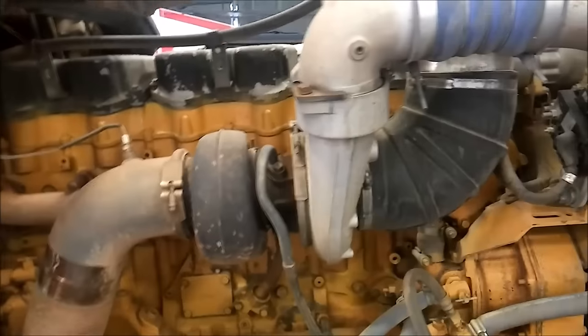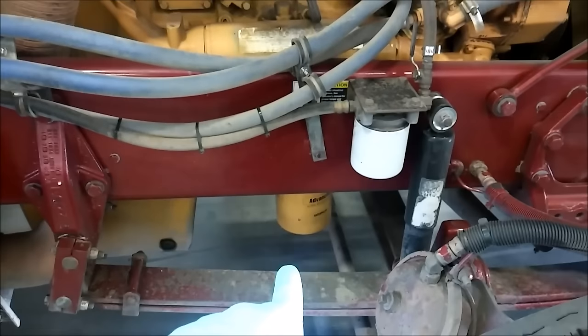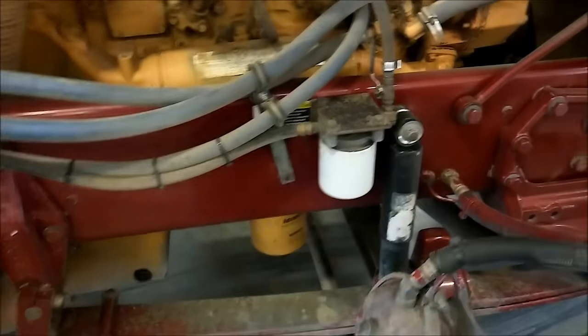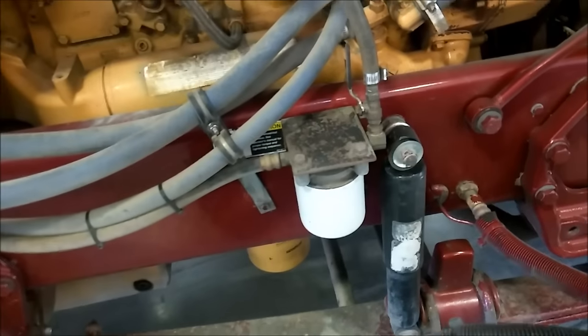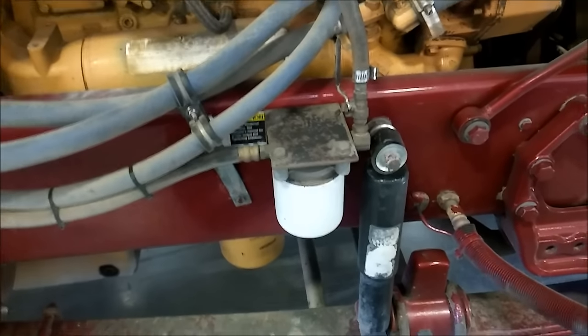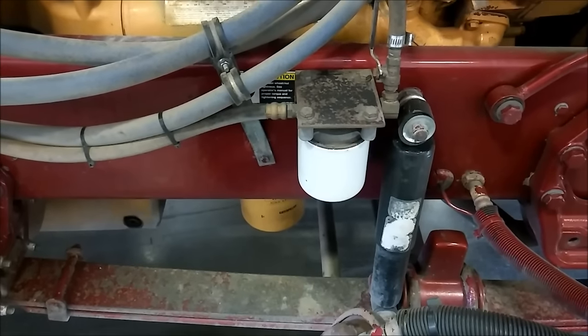This video is going to show you how I do oil changes and the rationale behind it. That's not to say how some people do it is wrong — it's just how I do it. We have your oil filter there and there's a coolant conditioner. Some people call those filters, but that's not a filter. You should not change that with every service or else it will throw your coolant concentration off, so don't worry about that.